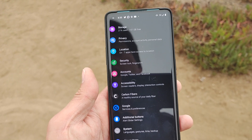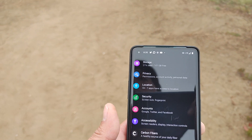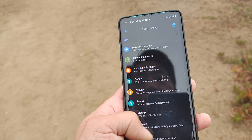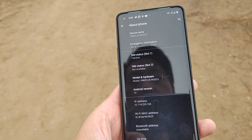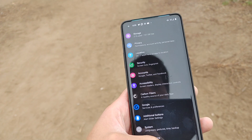I simply install TWRP — the process is a little more complicated because TWRP doesn't delete data, so you have to actually flash a data-erasing image. But otherwise you just install that, then install the GApps, and you have Android 10 Carbon ROM with a bunch of customization options.